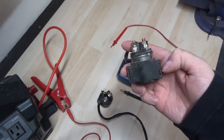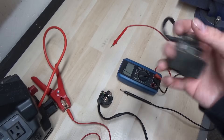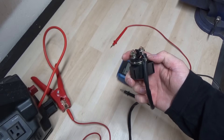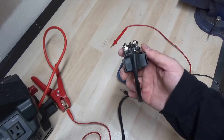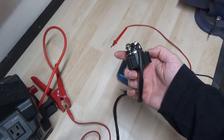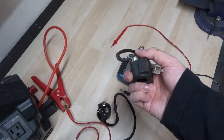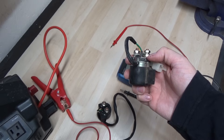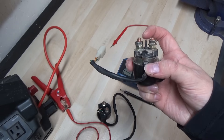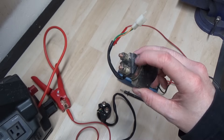If you have an old solenoid where the magnet pickup isn't working, you can take it out and maybe hit it with a hammer if you want to save some money. The new solenoids we purchased were from China — about $10 — and we can charge them out and make a couple bucks. If I had to buy this in Canada, they were like $35, but I ended up getting two for just over $20, saving myself and my customer a little bit of money. But if even that magnetic pickup works, if you don't do a continuity test between the two terminals up here, chances are because there was corrosion in there before, you're going to have corrosion up here as well.